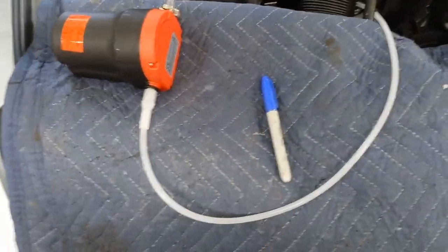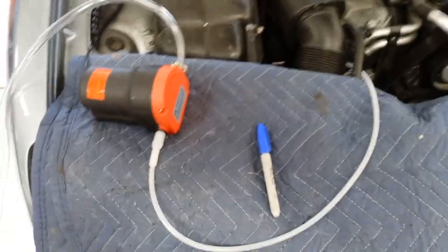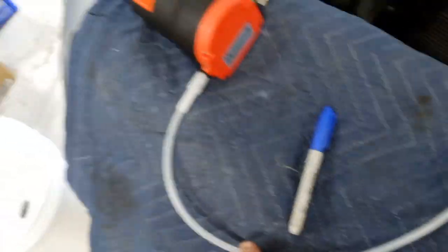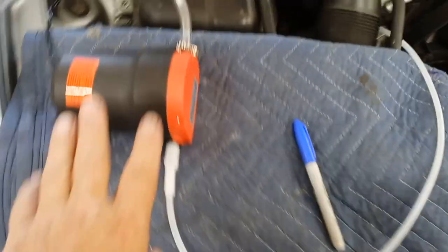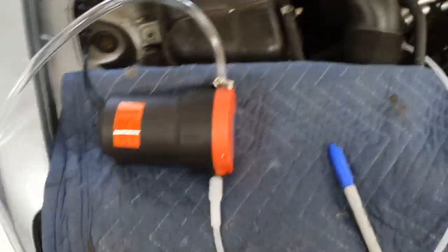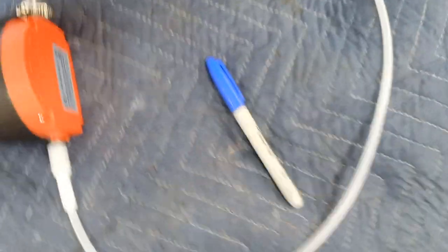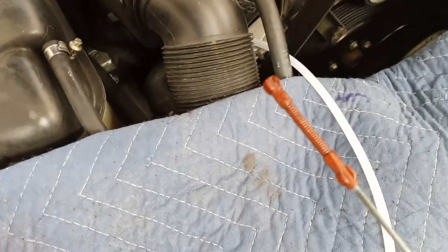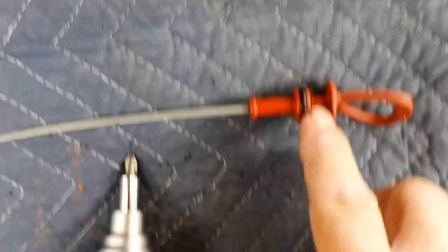This is the first part of draining the oil from the top. This little electric pump — I paid about 25 bucks for it on Amazon, somebody on the Crossfire thread gave the link — has a tube that sucks the oil out. You can see it's down in the dipstick tube. I laid the tube out against the dipstick cable and marked it off at the right length.